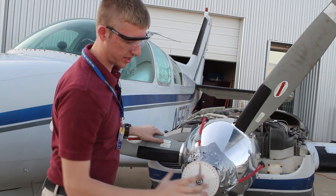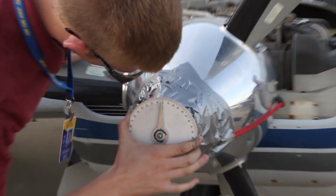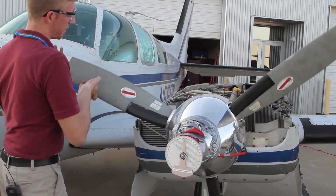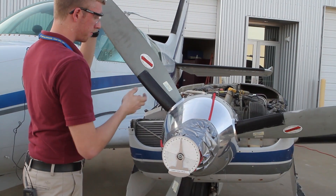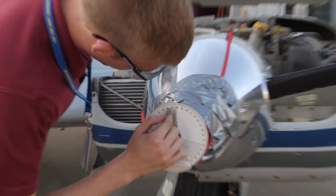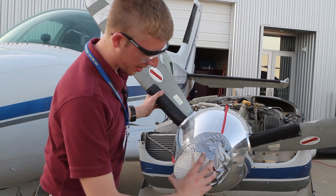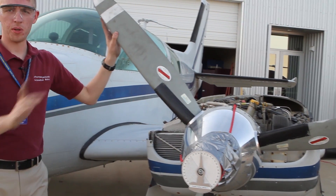It has lightly contacted the piston, so we need to set this timing disk to zero. With the timing disk set at zero, rotate the propeller in the opposite direction of rotation all the way around until it contacts the piston plug again. Here it has contacted again and we read the number — it says 78. Since we're at 78 we need to take half of that to find our position for top dead center, so we're going to set this to 39 very accurately and then remove the piston plug.